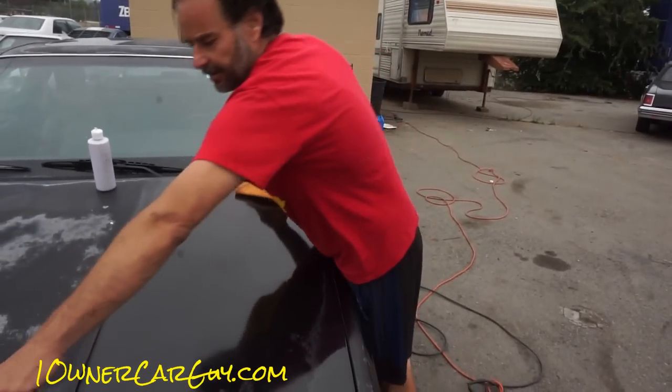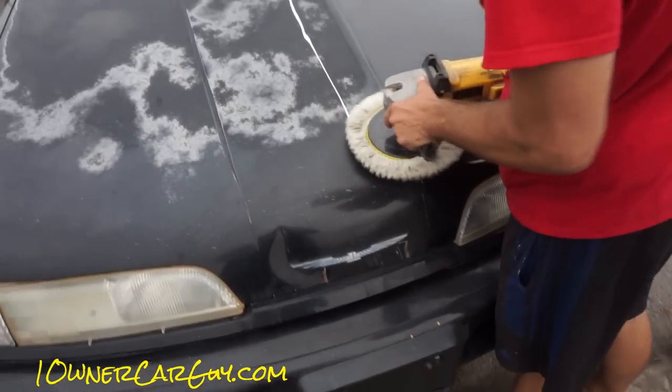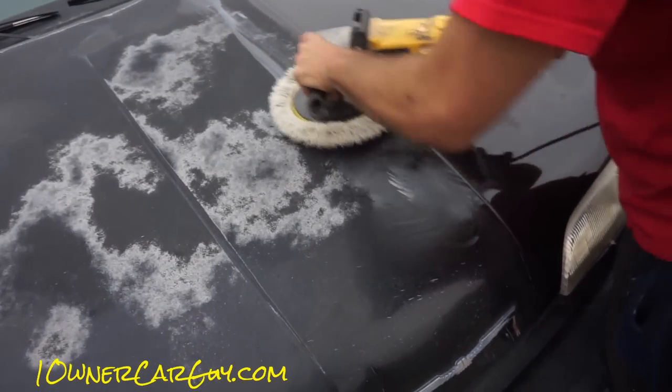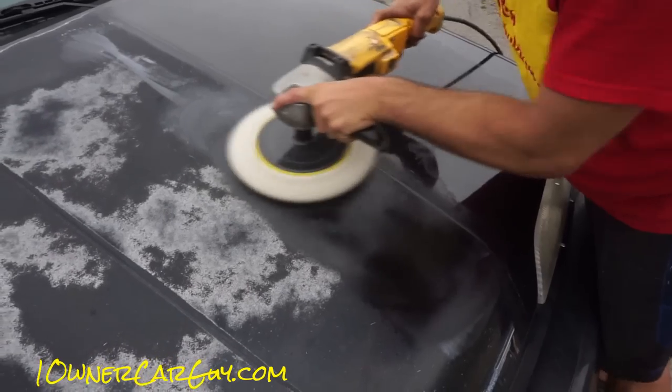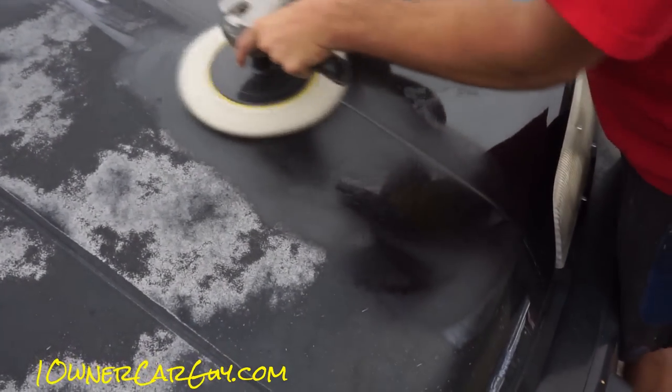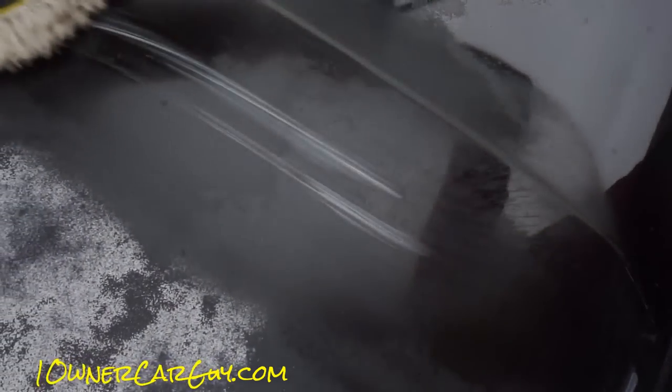That panel is freaking looking good. What I'm going to do here is nail a halfway mark and buff the heck out of it. Rub this stuff around a bit first. You can see it taking that clear coat haze right off — marks just go like crazy. Give it some pressure. It doesn't take much, but when you've got paint looking like that, I want to get it off now.